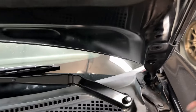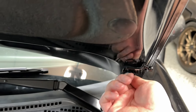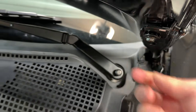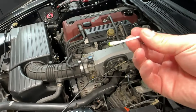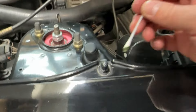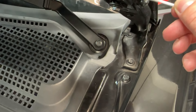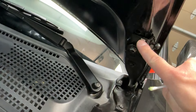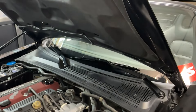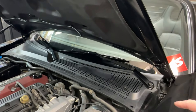On the hood side, grab your setup with the bolt, the larger washer, and the locking washer, and tighten it on. You can see the bracket follows the contours of the skeleton of the hood. I have some grease and I'm putting a little bit on these ball ends — the pieces on the strut are already greased, so I'm just lightly greasing these. These brackets do have some play, so I'm going to install the struts and then raise the hood to get them evened out, adjusting the brackets evenly left to right, then tighten them down.